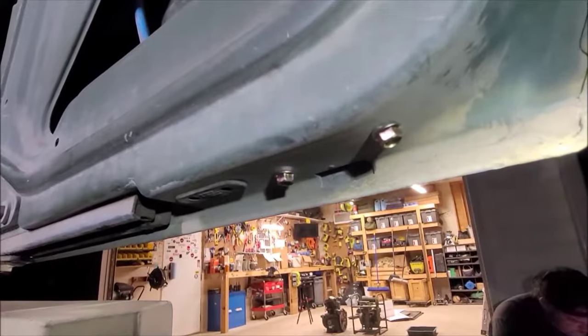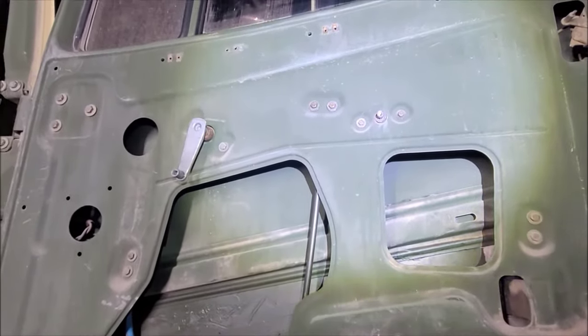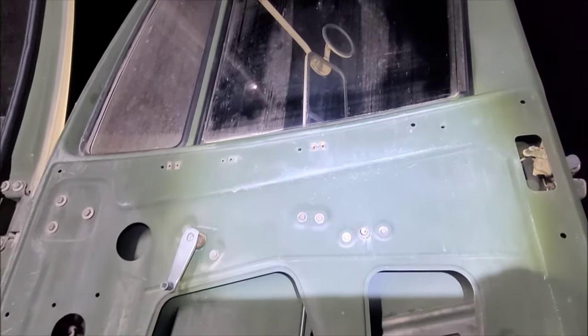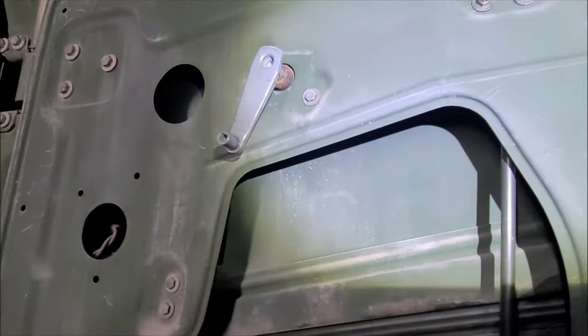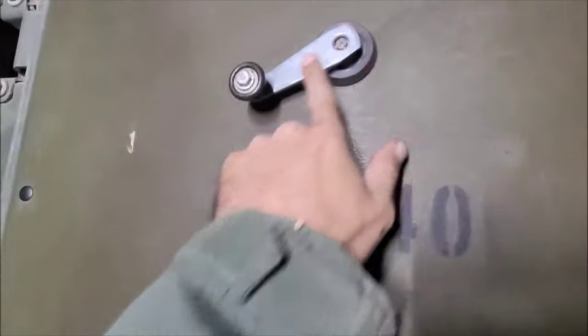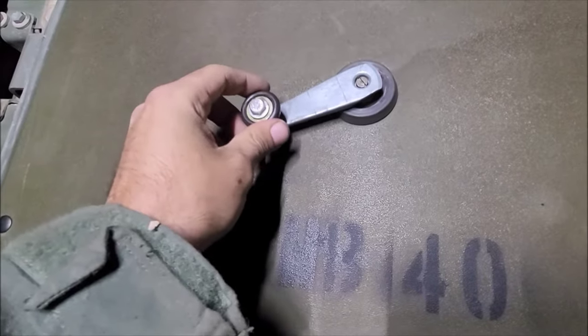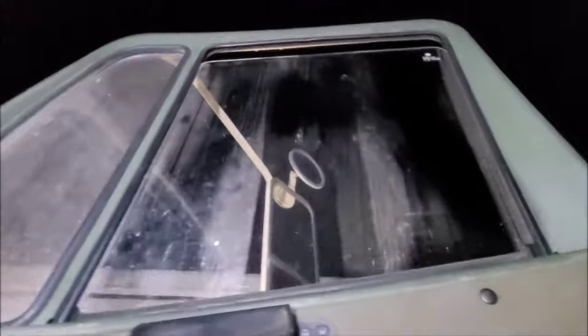It's not binding anymore. What I did — and this is not my typical type of fix — but I drilled a hole to make sure the track wouldn't pop out and put it into that scrap piece of 2x4, and that holds it up where it's supposed to be. The window goes up and down fine. I just put a couple screws to hold it in place. The reason I went with such a cheap fix: one, I wanted my window to go up and down, and two, the cheapest regulator I could find was $165. This was nothing. So if it works and it lasts a year I'll be happy. While I had this off, I found a bolt for the knob which had just been sitting on there loose. I used a lock bolt and some washers and put all new little press fits in — better than it ever was.